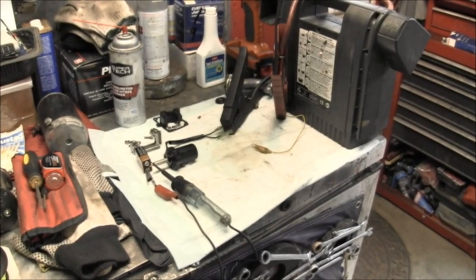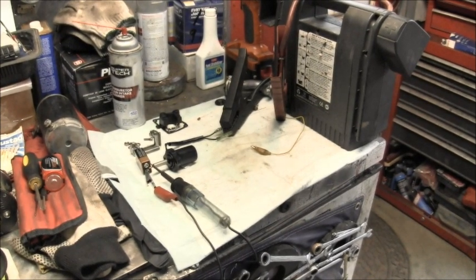Okay, these Yamaha around 2000 to 2004, they changed it in 2005. Instead of a manual choke, or even a true electric choke, they came equipped with, bolted right onto the carburetor top, an electrothermal device, an enrichment device, they call it. And people spend a lot of money on these things for this particular series of Yamaha 9.9-15s. And they don't need to, because the device is most likely working. I'm going to show you how to test it. Or else the way I do it, and it's simple.